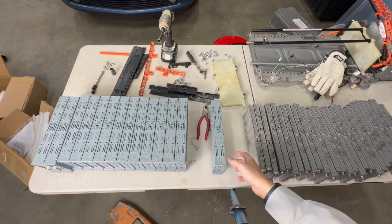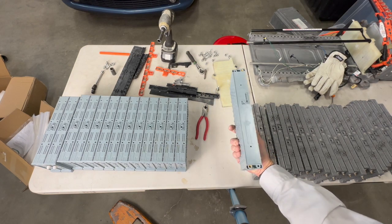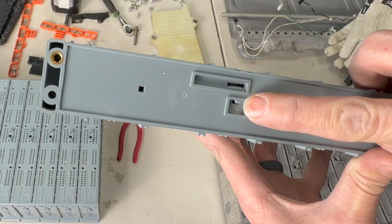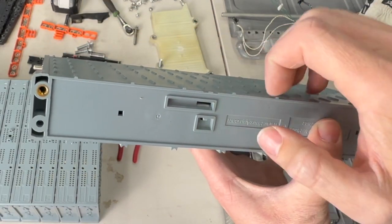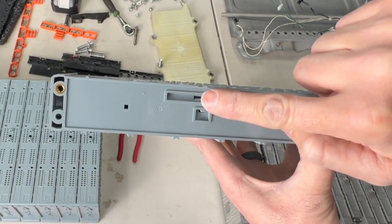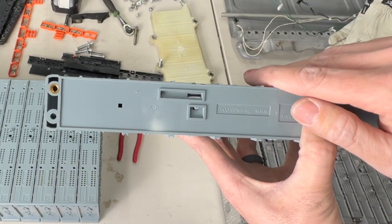I want to get some close-up footage of where on this Gen 2 Prius we're going to put the temperature probes. Now, NexPower has done a really good job at making everything as simple as possible. If we zoom in here, we can see there's an opening at the bottom with a clip here and then a clip right on the outside to put that temperature sensor on. When we put these in, we've got to make sure we fit it the right way to have good contact for the temperature sensor, and make sure we're getting an adequate battery temperature reading into the battery ECU.